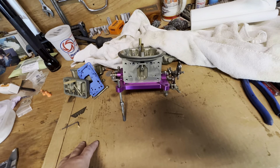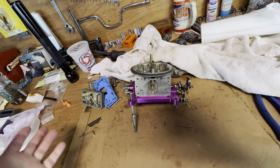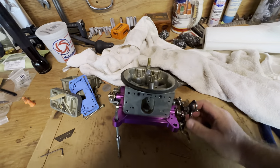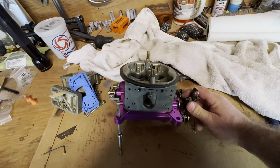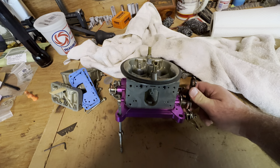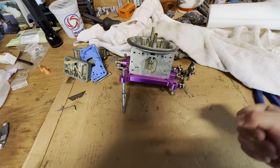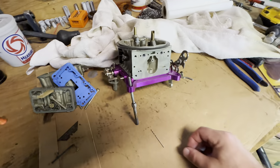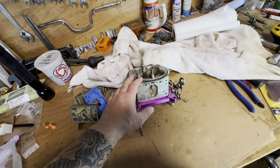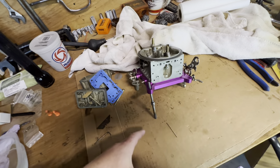I figure I'm going to try a 65 and see if it curbs that. Carburetors aren't as hard as people think. You know where it works: closed is the idle circuit; cracking it is idle transition; mostly transition, then right into main jet; and then once it really drops vacuum, it's power valve and main jet. If you have an air-fuel ratio gauge, I suggest everybody has one when they start doing this — then things will start being logical. With bigger engines, you'll be cruising down the highway just in idle and transition for the most part; you won't even get into the mains very often.